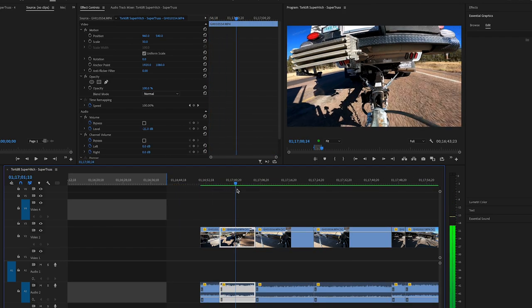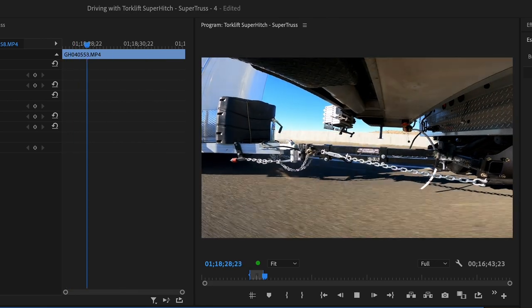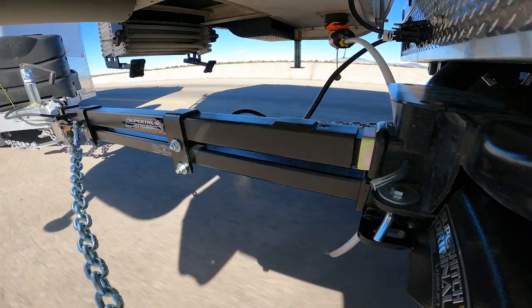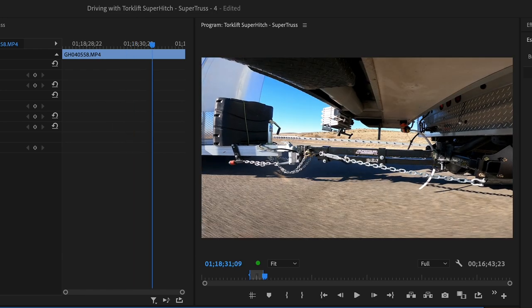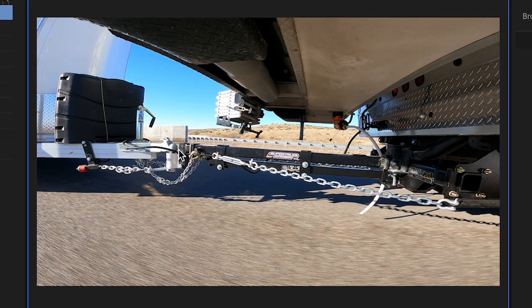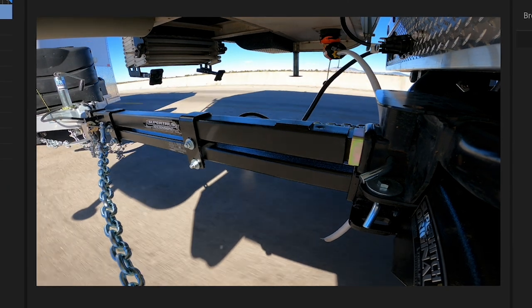You can see there's some bouncing. These two clips are the worst — from the angle, you can see the bouncing happening, and when you zoom in you have some play in the hitch. I didn't have a hitch tightener that would fit this setup — the threads on the one I was using on the old setup actually let go and I didn't have time to order one. Most people run these without a hitch tightener, but now I'm realizing that with that amount of play in the hitch, it likes to bounce. What makes the bouncing even worse is the way I have my weight distribution set up — it's almost at equilibrium. The amount of lift the weight distribution is providing makes it almost float, and you can see that in the way it behaves. Having the weight distribution at equilibrium is going to make the bounce much worse.